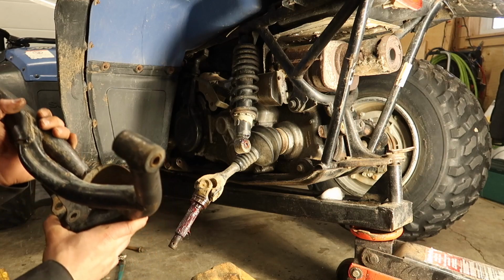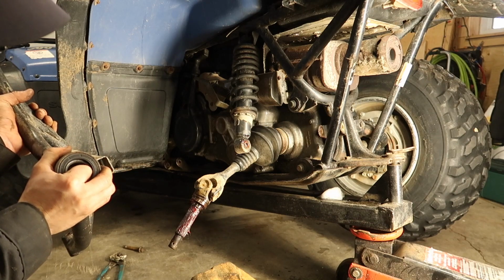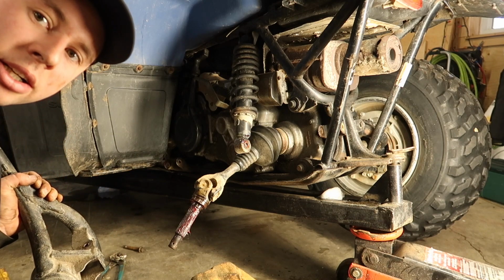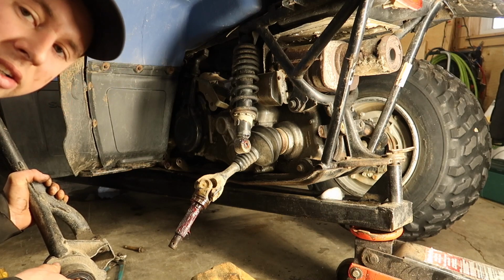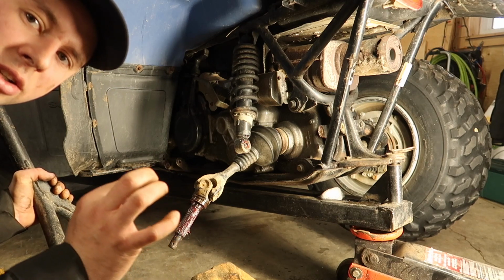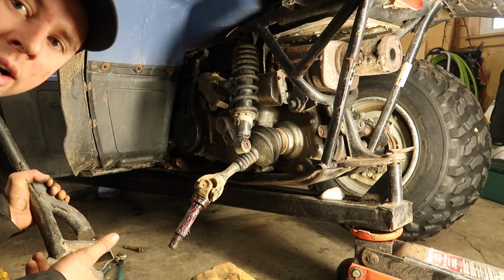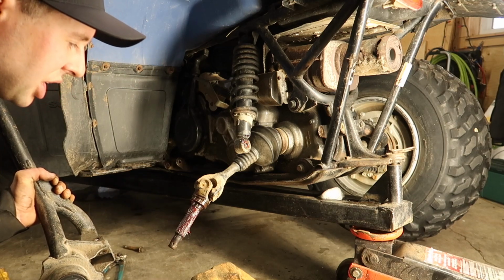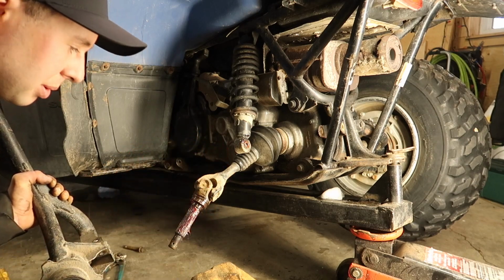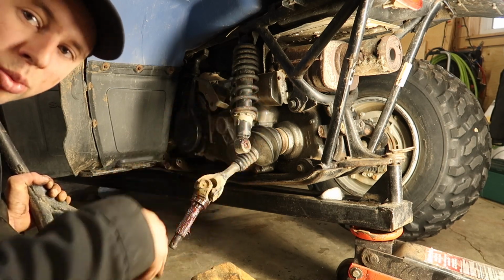So I did notice that now that I put my seals in and I banged around in there a little bit more, my collar, I can still move it fine, and it's just touching. So that collar must touch the bearings. I figured that's why it was in there. I just didn't understand it before, but I pounded it until I heard a hard knock, and I felt the rim on each side, and those bearings were in there, so it's kind of puzzling me that it's so snug in there. But Suzuki says that you want it loose. I'm thinking it's for install, because everything's going to get sandwiched together when you put your axle nut on and tighten it up. But anyways, we'll swap this back on.